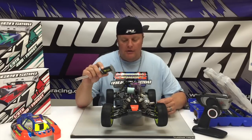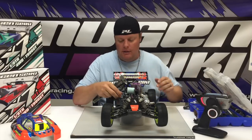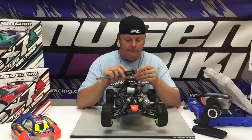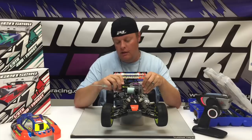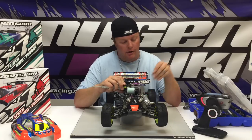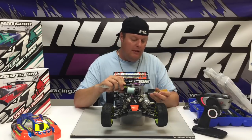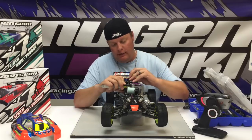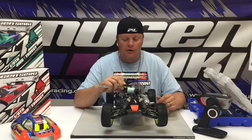But you just take a pair of digital calipers. Well, first we'll go ahead and turn the transmitter and radio tray on. Take a pair of digital calipers and measure the carburetor distance from the mid-speed needle to the low-speed needle. You'll zero out your calipers because this is basically showing you zero or neutral, so the engine at idle.